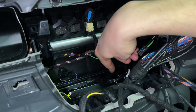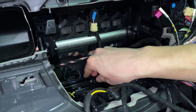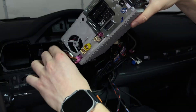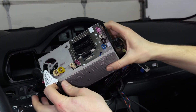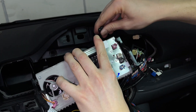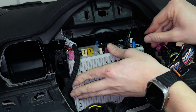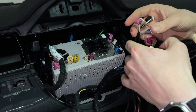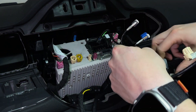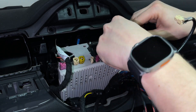At this point, start hiding the module behind the dashboard. Having it there out of the way, the head unit can go back in place. If it sticks out there would not be enough space, but as you can see it fits. Now take the head unit and start putting it back. Remember the video cable is now connected to the module. Don't leave the fiber optic cable behind — it tends to stay behind. Once the bolts line up, tilt it back and start connecting the antennas, starting from the furthest one. Connect the pink one and lock it in place, then the white one, and finally the blue one.